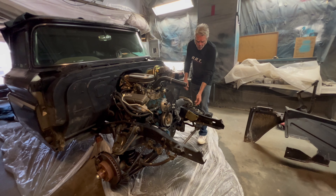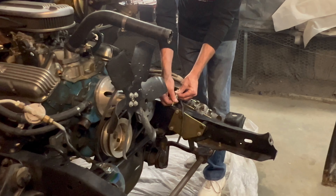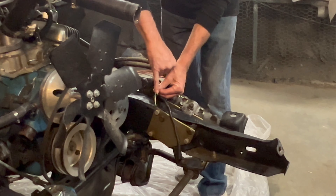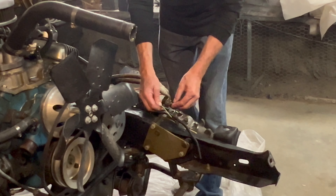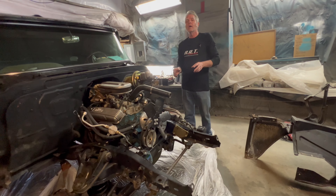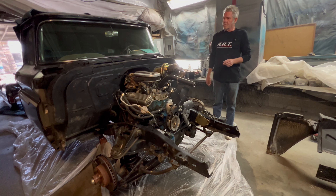When you're cutting your electrical, don't cut it all in the same spot. You want to stagger it so you've got about an inch and a half between each one. If you do all the cuts and all the repairs in the same spot, you're going to have one large lump in your repair. By branching it out like this it's going to be more even, and you won't have that snake-that-just-swallowed-a-pig look in your electrical system.